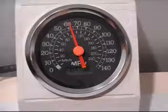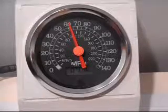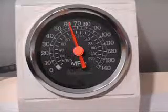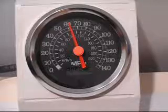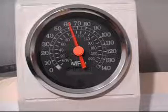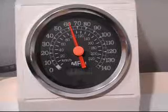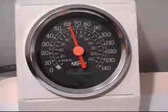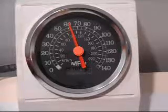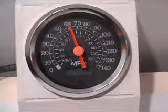If those pulses are not counting up, that means the speedometer is not receiving a signal. First, check what kind of sender you have and adjust your DIP switches — you may have to play around with them a little bit depending on the sender. If that checks out, go through the troubleshooting listed in the manual to check for a speed signal. Also check your wire continuity all the way up to the plug coming into the speedometer, in case there's a bad crimp.